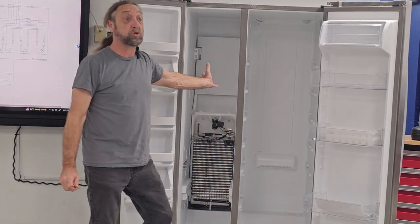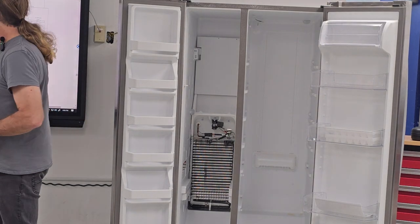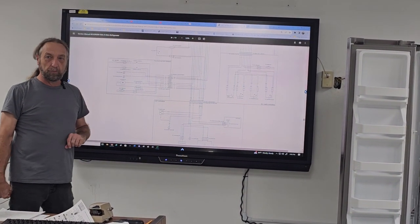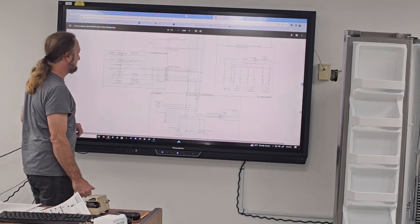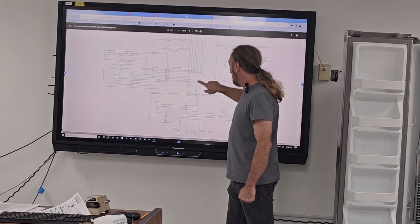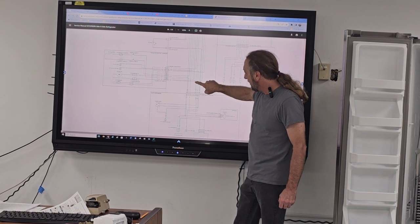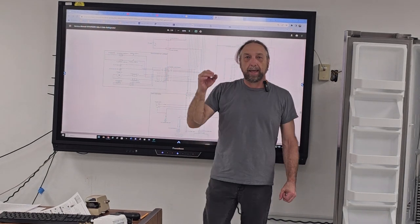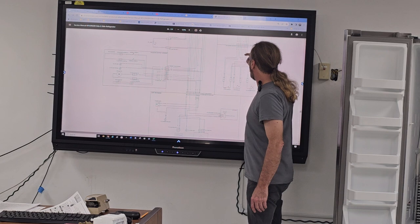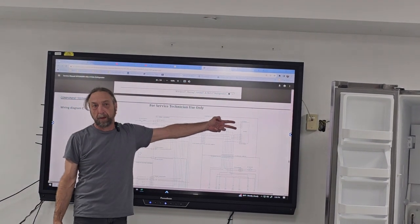Remember we're using freezing cold air in our refrigerator — if I put too much of that air on this side I will freeze it. Is this evaporator fan motor 120 volts or a low voltage fan motor? It's 120 volts. How do you know? You'd have to trace the circuit, but this white wire is neutral. The power cord is right here — if I follow the white wire coming off that fan motor and follow it down, it connects and goes right to the power cord. If a component connects to the neutral in that refrigerator, it's 120 volts.